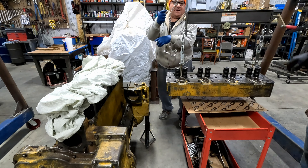The part number is going up. They can only go one way because there are dowel pins in the corners of the block. We're not going to put anything on this head gasket because this is a fiber head gasket, so I don't think it's going to leak or have issues much like the solid steel ones do. I need to go a little higher.